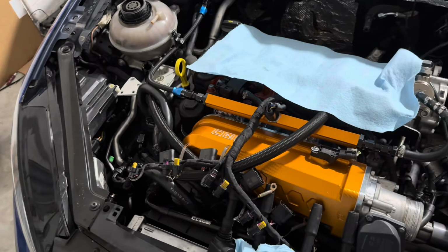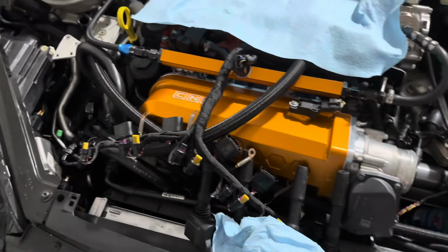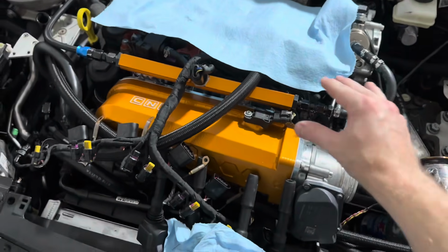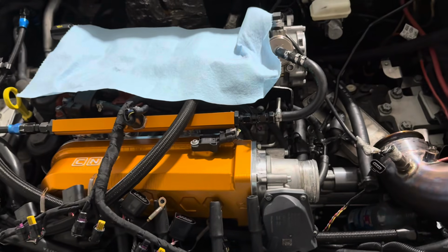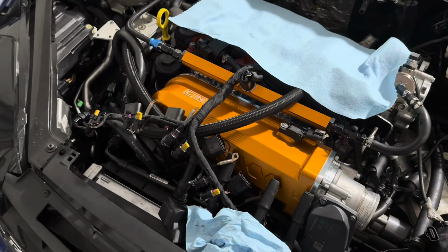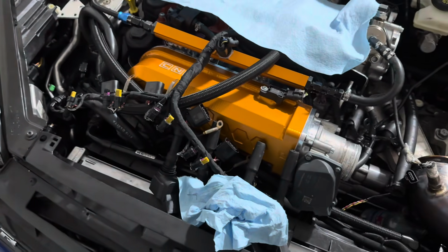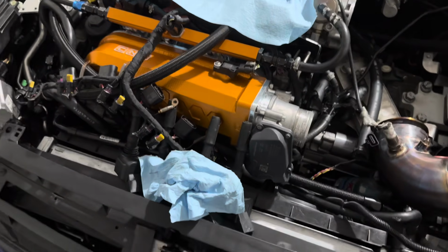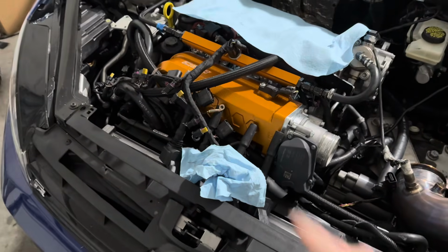Low pressure system, everything's working great there. If anything, it's actually making too much pressure. I can only run it at about 40 to 50 duty cycle for it to make my base pressure that I want, which is around 7 to 7.5 bar. I tried to throw like 60 at it just to see what it would do. And on 30 pounds, it made 10 bar. It damn near maxed out the low pressure sensor.